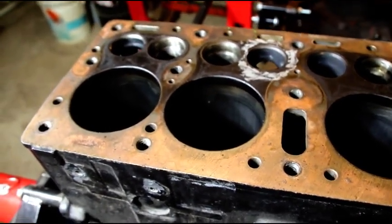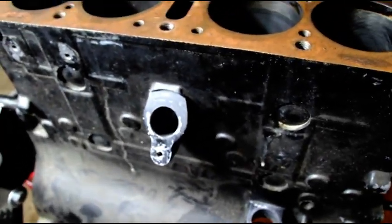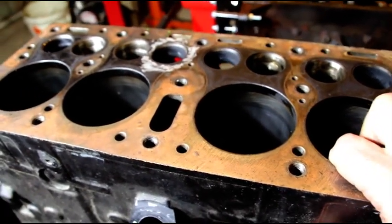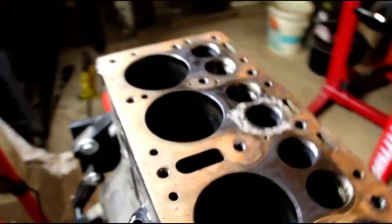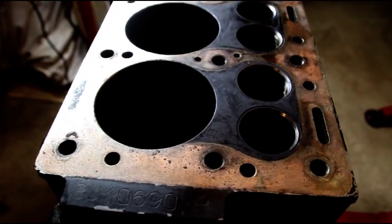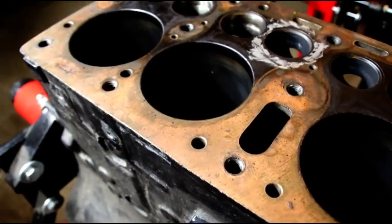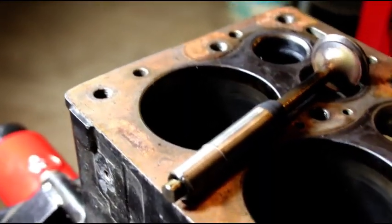The valve seat issue can be fixed, but I don't know why the valves wore so badly. I'm going to get the valves out and show you how much the valves and guides are worn. I don't like this block and I don't feel comfortable — I don't think I'm going to be able to put out a good engine for you, Brian. I think we should look for another block. The engine builder should have picked up on this — it's not built to any kind of quality standard.